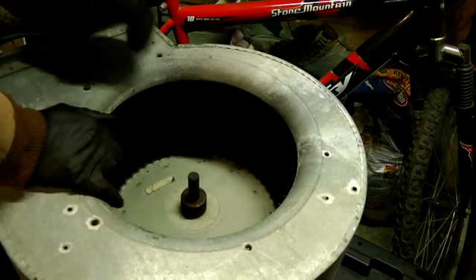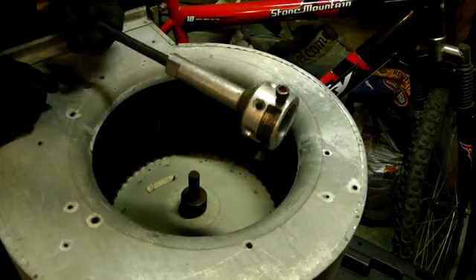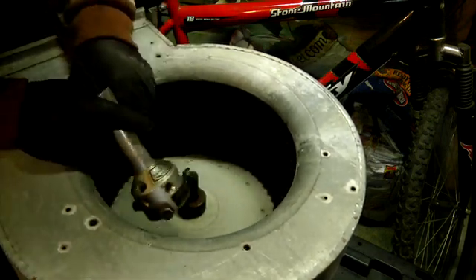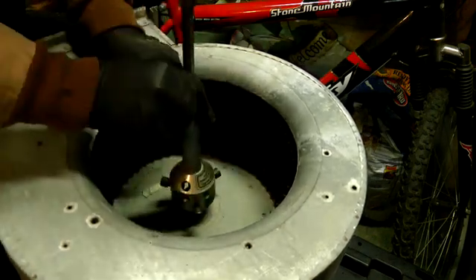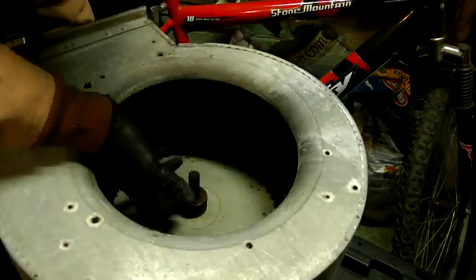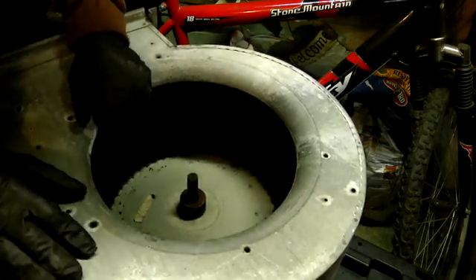When they won't come loose, you have to have a special tool to remove the squirrel cage from the blower motor. The shaft is too long to fit the tool on here, so I'm going to have to take a cutoff tool and cut it off shorter so that the tool will fit onto the shaft.